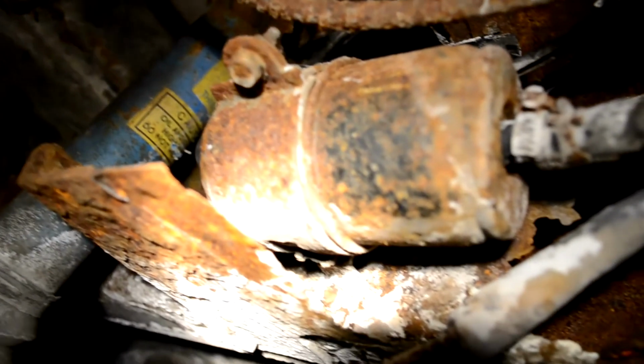We had started taking the mount off and realized that the hole was getting bigger. There's another hole in the same section of frame on the inside that's a little bit worse. So we got a new mount. Gonna take this off, box the whole section of the frame, and get her fixed up. And as you can see, the undercarriage can use a little lovin'.